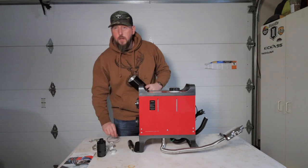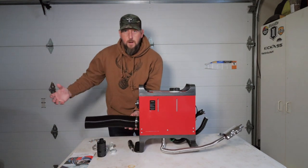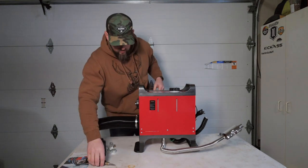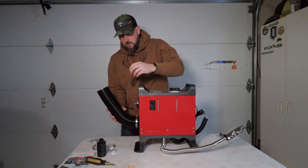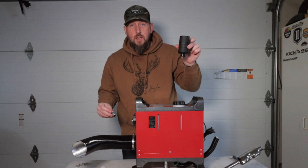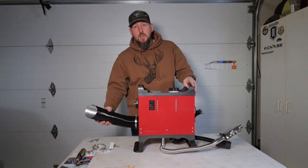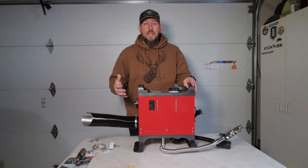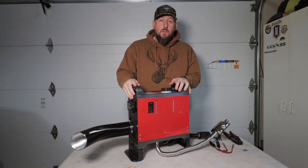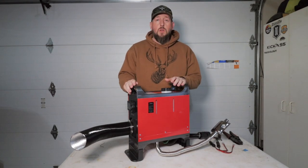Next, we can take the larger hose clamps and attach tubing to the front — this is the warm air exhaust, so this will be pushing out the hot air. Just making sure it's not over-tight, but snug enough. Then we'll attach the air filtration to make sure that doesn't come off. Now, if you're going to run this for your rooftop tent, you'll just exchange this little tube out for a three-inch insulated ducting hose and run that up to your tent. Now that we have everything put together, this is the setup I'm liking so far.